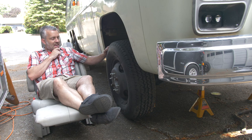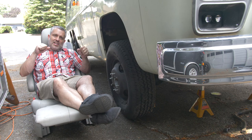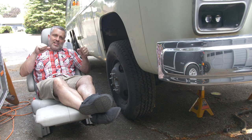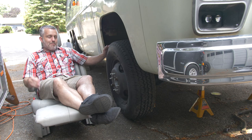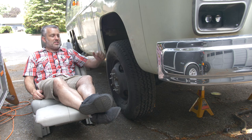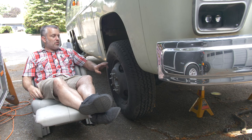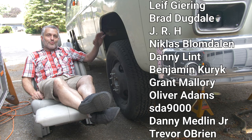For now, I think I'm just going to crank up the spring like everybody else does and see if I can deal with the reduced spring rate and the diving behavior. The final thing I want to mention is that I can barely get a piece of thick cardstock between the brake caliper and the rim, which means it's highly likely this rim is going to rub that caliper under steering conditions. Manny tells me the caliper is plenty robust — I can grind it down and give myself a little more clearance. Alternatively, I can get the Alcoa aluminum rims for extra clearance. But for all the reasons covered, I do love these steel hub-centric rims, so I think I'm going to grind down that caliper and call it a day.